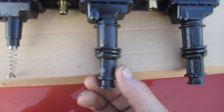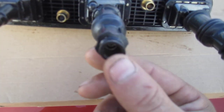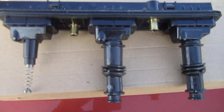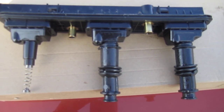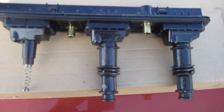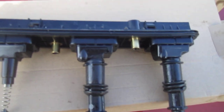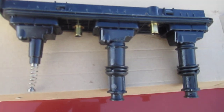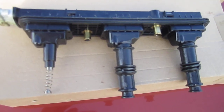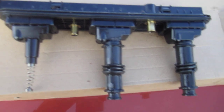These boots have been sitting in that oil too long and they've swelled up. The only way to solve the problem is to keep removing the plenum and pulling your coil pack off to check those chambers. I don't know exactly how often to recommend it, but I'd say every couple of months. It's not a really big job taking the plenum off - it's kind of a pain though. Too bad they didn't design it a little differently, especially on the 3-liter. Thank you for watching, subscribe if you haven't, and thank you to those who have.